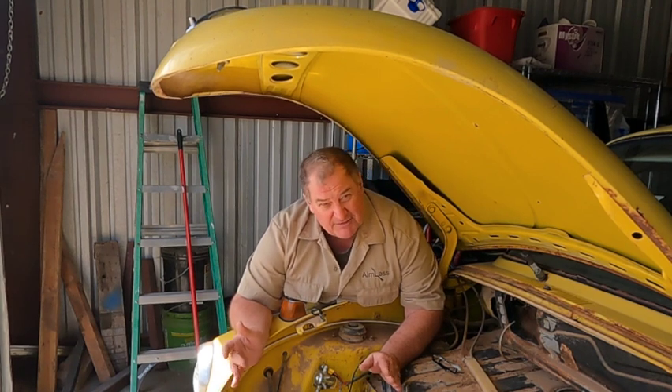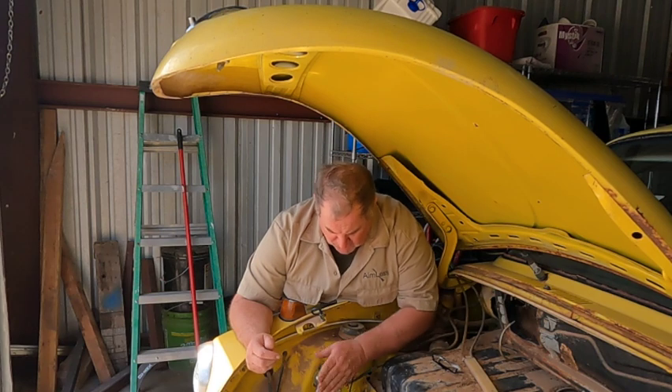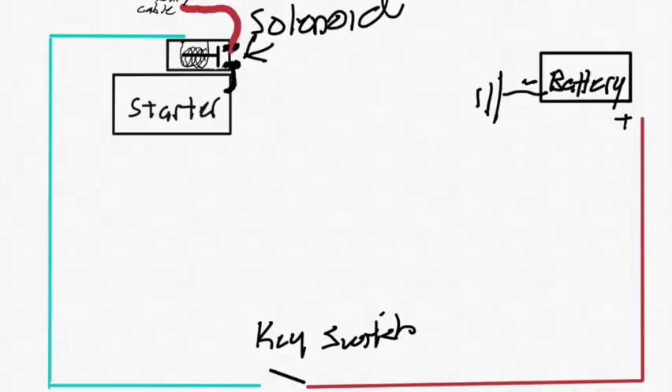Let me explain a few things about solenoids. On a Facebook group I asked about where this solenoid goes, and a guy commented that you shouldn't add solenoids because you're sending more current to the starter and the wiring can't handle it. Let me explain how this works. On top of your typical starter is a big round thing — a solenoid. It has two jobs: it kicks the drive gear out mechanically, and it has a heavy set of contactors on the back that close and allow straight battery current through heavy wires to turn the windings of the starter.